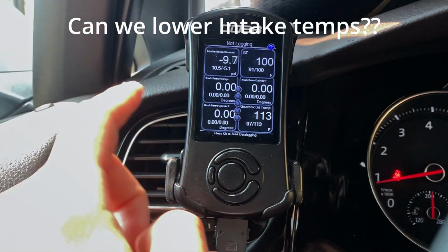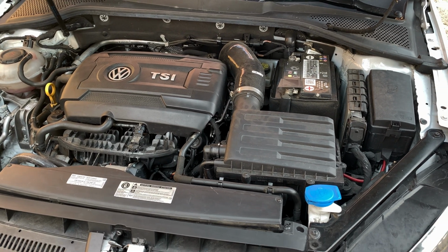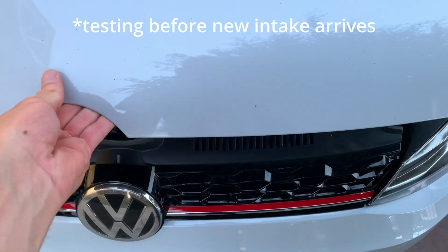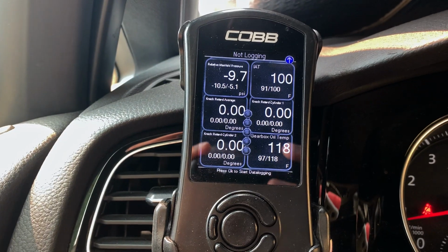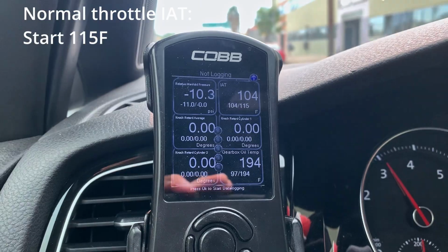I'm heating up the car right now, but we're gonna take it for a quick run. Right now, everything is factory airbox, just a drop-in filter with the MST inlet silicone hose and inlet pipe. So just your typical stock modified airbox, nothing else done to it. We're gonna test it out like that, and then we're gonna come back, take off that inlet air duct, and drill some holes on there, pop it back in, do another test run, and see if our IATs will drop